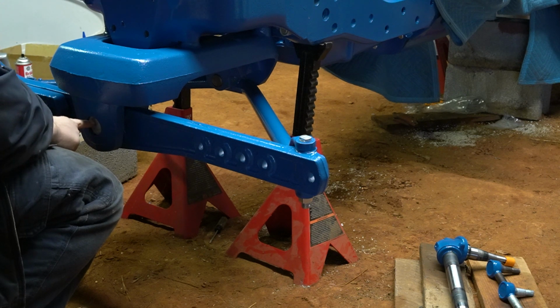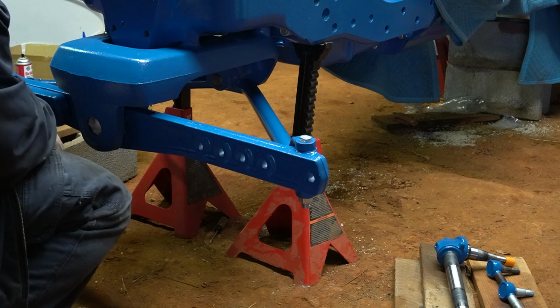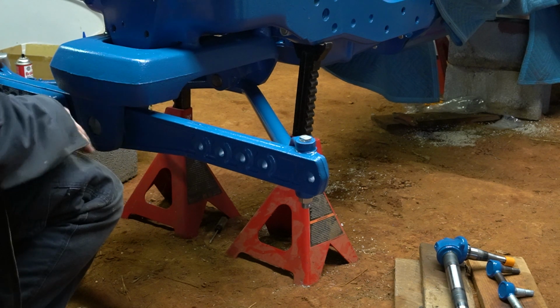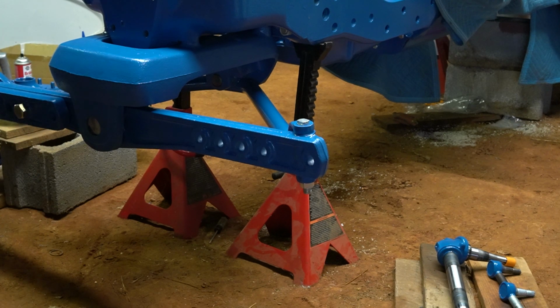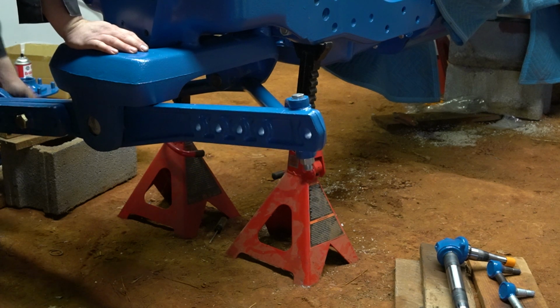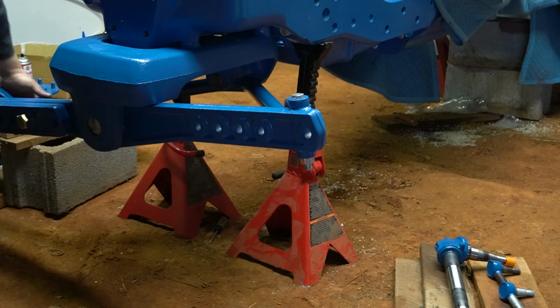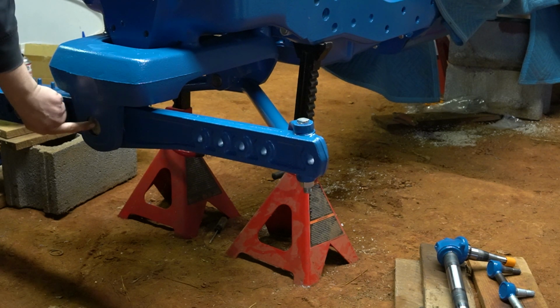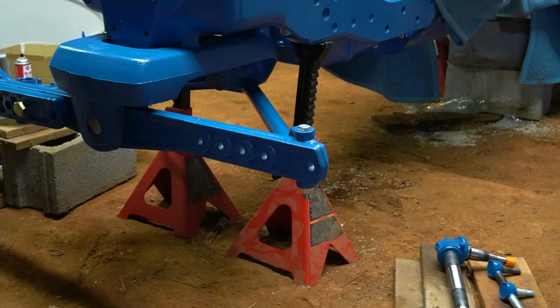That and the groove I got cut in this kingpin here is a little deeper than factory. I don't want to try to pull that wedge all the way out or through it. But our axle still moves. Like I say, she's stiff, but it's kind of expected. Well, actually I'm going to have to tighten it down further because this kingpin is pivoting. So I'll have to go get a deep socket and torque that down, make sure that doesn't rock on me.